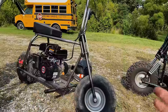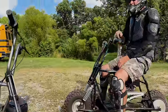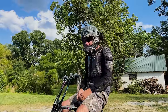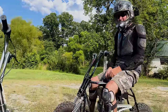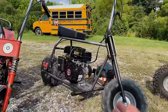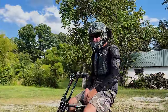And these tires aren't great if you're going fast, but for the amount of power that it has, it's perfect. It's the turns that those tires have a problem with. Going around corners, straight line they're great, but turns not so good if you're going really fast with a lot of power. If you have not a lot of power, it's no big deal. That thing really surprised me. Yeah, it really did. And if you put a taller or a shorter rear gear on it, you get a little less top speed, but you get a lot more acceleration.